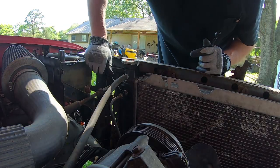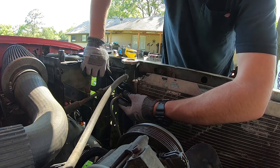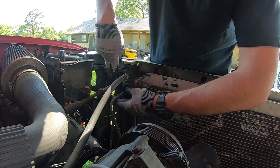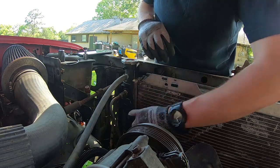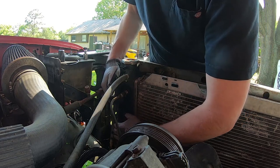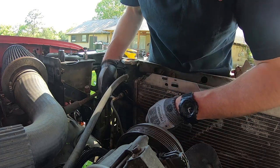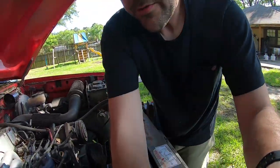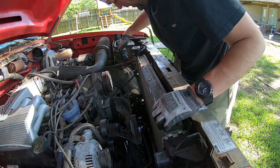I learned from my own mistake here - I tried to undo the upper cooler line and I did in fact twist this little line. Learned the hard way, but to remove this you're going to need to have at least two wrenches ready to loosen this up and it will pop right out. Let's not go into detail about the 'oh no' face, but we're going to remove the upper then the lower and we're ready to pull the radiator. You see that bend - that hurts just to watch. No more twisted lines.